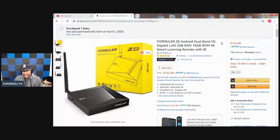Just know we have a lot of devices on 2.4. It could be a cell phone, your cordless phone, or remote controls. Usually anything that's wireless in your house is probably on a 2.4 network. That's why it's so crowded compared to the 5G. Nowadays cordless phones are like 5.8, but a lot of remote controls are on that 2.4 network.